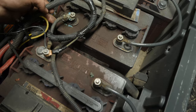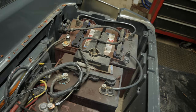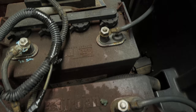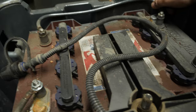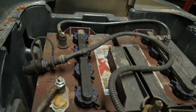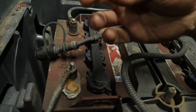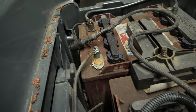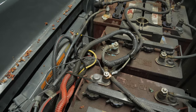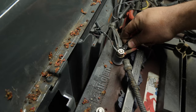I see a lot of corrosion on this battery here. You can see how that terminal is really, really loose — that might be a potential culprit. What I like to do is go around to each battery terminal and post and just wiggle it. Some of them are a little funky. What I'm going to do is replace the main negative with a stainless steel 9/16th nut. We are in run mode. Any of these ends that are weak, we're going to snip off and redo. Everything else seems to be in order and pretty tight.